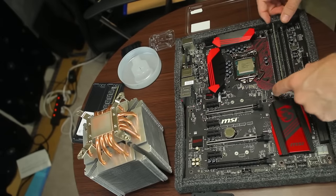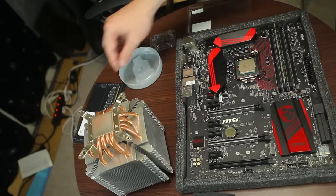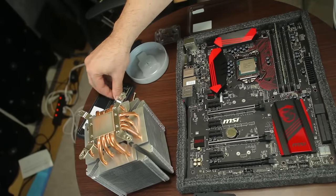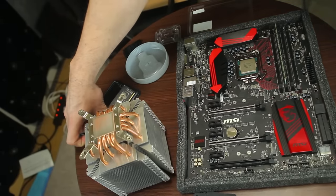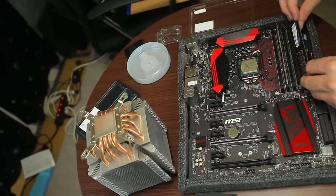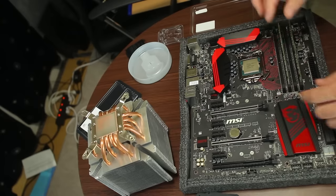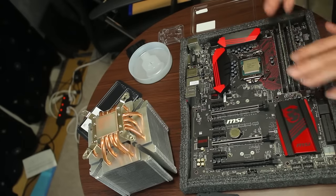And now the good thing about this board is I like it. It's got DIMM 2 and 4 printed there, and it's got first. So that's very easy to understand because it's a dual channel supported motherboard. Generally you want to have your memory running in dual config. And that's what we got. So we've got 2 8GB of DDR4 memory going in there.